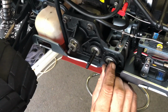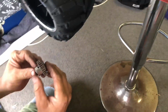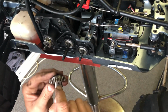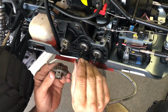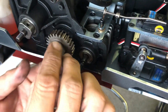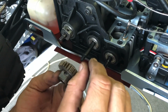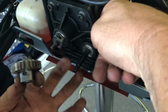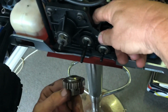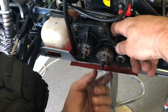All right, now we're putting these gears back together, okay? So what I'm going to do here is, making sure you know what's what here. Like I said in the other bit, see your little grub screw there, you got the flat section, if you can see that on the shaft there. The grub screw has got to go on that, so when you tighten him down, it's got a flat area and it'll do up nicely. So I'll just put this one back on because it's easiest to get at. If I can get that right in the first place. Now you can put your finger down inside to hold him, because it's not a drive shaft. It is a driven shaft, not a drive shaft, if I got that right. So you can line him back up to there, and that will go onto that flat section.